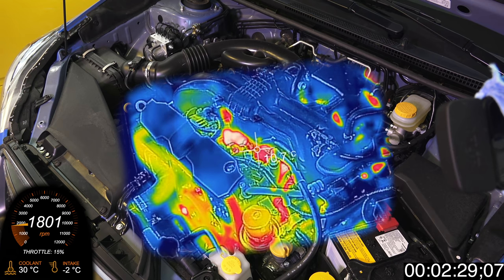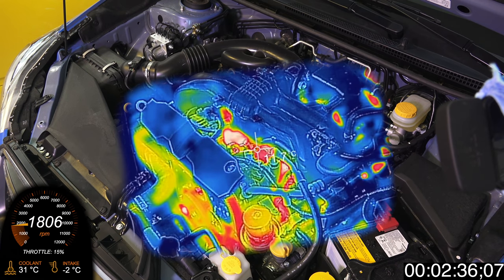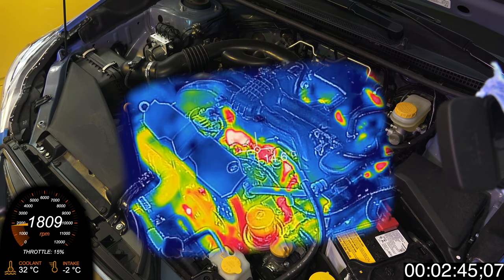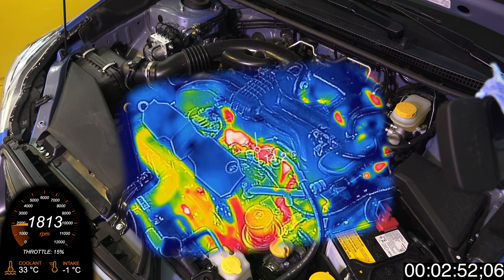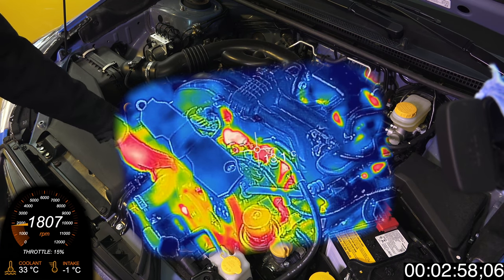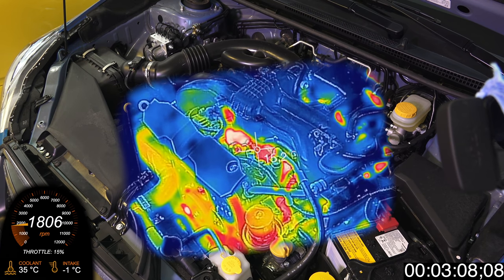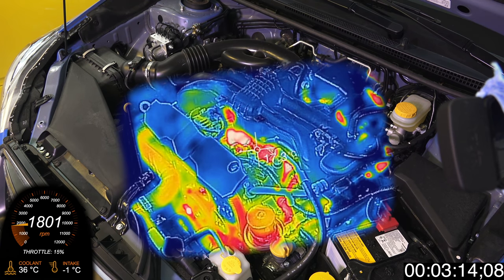Try to keep the revs low and be light on the throttle until the engine is warmed up. Getting to higher vehicle speeds is fine as long as your acceleration is gentle and steady and you're mindful of your engine RPM. Now inevitably someone in the comments is going to say they live in an area with negative 40 degrees C temps and always warm their car up for several minutes. A couple of things: first, that's obviously super cold and I can't blame you for wanting the interior warm. Second, make sure you're using a viscosity grade that can flow in these conditions — 0W is designed for this. Third, with temperatures this low, it's a good idea to get an electric engine block heater so your engine won't have to strain so hard to get oil flowing. And finally, point number four — move to Florida. It's warm and sunny and you don't have to worry about your face muscles freezing in place.